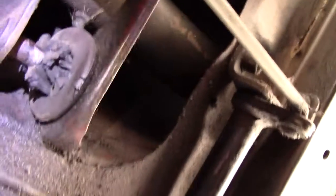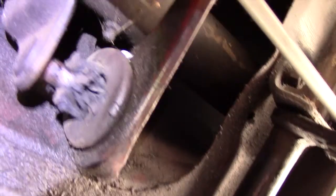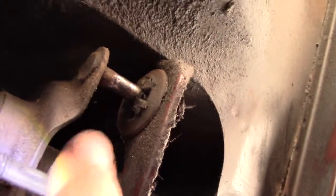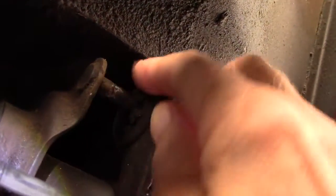Toward the back here we have the center U-joint area where there's a bearing and bushings supporting it. I found that these pair of rubber bushings were totally shot. So I ordered a pair from England and they came in about a week, week and a half ago.